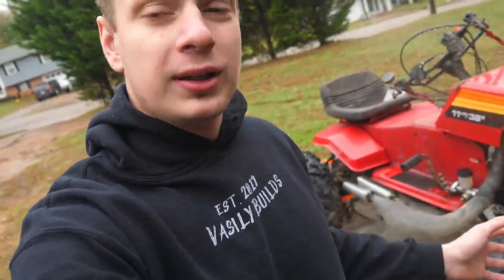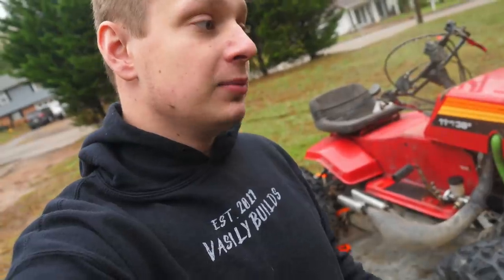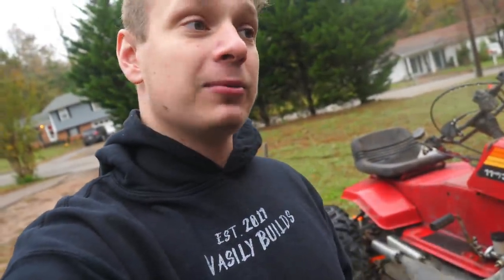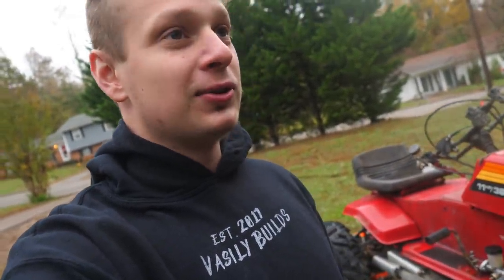Vasily from the future here, and after playing back the footage, I realized how bad it was actually bogging on the top end. So to me, that's an indication it was running lean. But I was on a time crunch. I was a week behind on this video, so I had to just send it, and this is my first time really taking it on some trails. So I wouldn't expect too much out of it, but I will make it up to you guys and get this thing dialed in. So let's get back into the video.